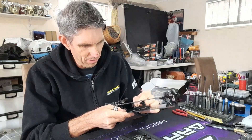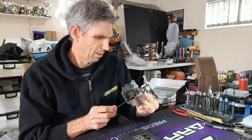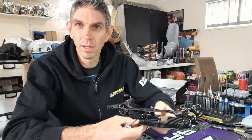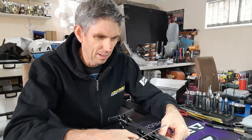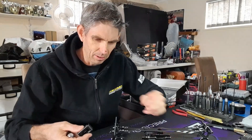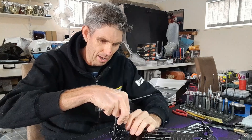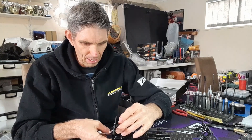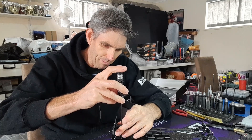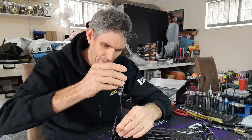Line up your battery stop — you want that coming straight out. Tighten it up. Now I know that's all going to be straight. Then I know the bulkheads are right. Another thing I like to do is stand the car up — hold it and tighten it up so I know they're perfectly square. The 18mm holds everything true.